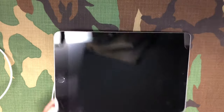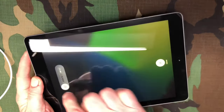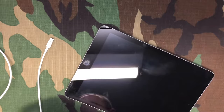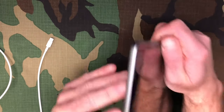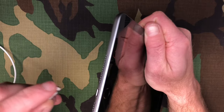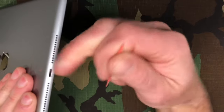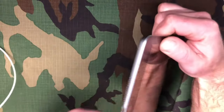There are two steps you can do. First, turn off your iPad since you're going to be messing with the port. Once your iPad is off, preferably use something wooden like a wooden toothpick. If you don't have one, you can use a pen or paperclip — just be careful with the electronics. The bottom of the port has metal prongs that your lightning cable connects to. Gently get your toothpick in there and remove any possible lint. iPads usually don't have as much as an iPhone since they don't sit in your pocket, but there could still be gunk and dirt caught in there preventing your cable from going in all the way.